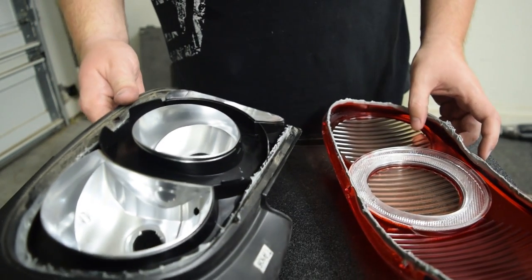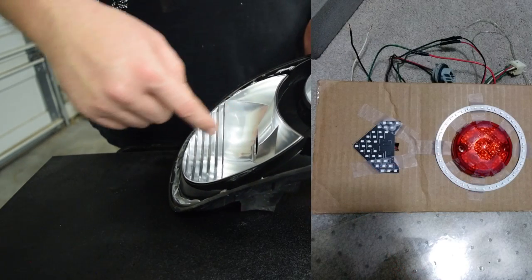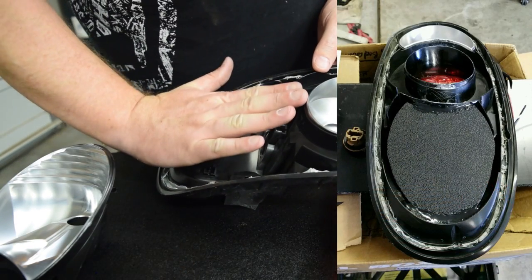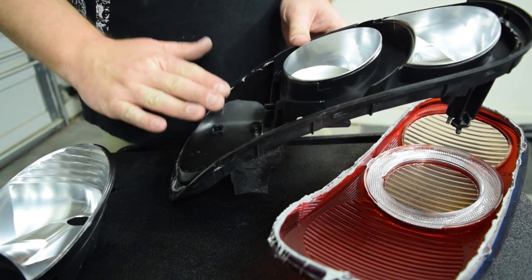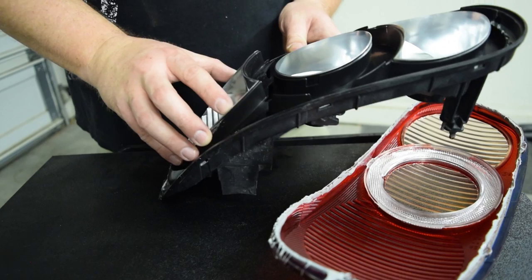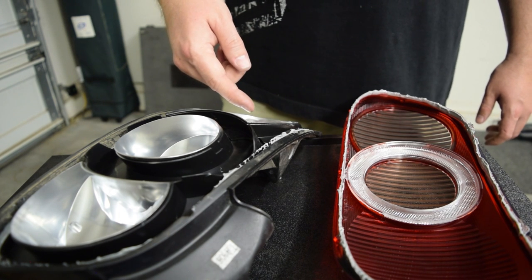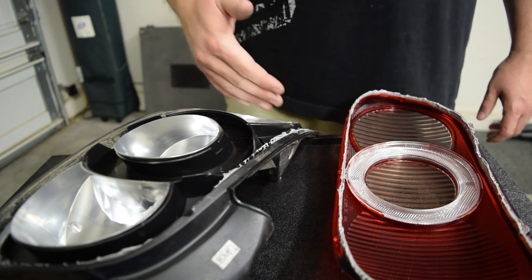I want to talk a little bit about the bottom base — we're actually not going to do anything with this. In my other taillight I used tracing LED arrows, and I had cut some ABS and made a plate to hold the LED. But I can see it inside the taillight in the daytime and it kind of bugs me. The bigger problem is that using an LED light as a turn signal doesn't pull the same load, so you get what's called hyperflash, and with the tracing arrows you only get the first arrow — the electricity doesn't flow long enough to trace all the way across.